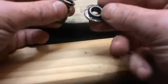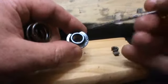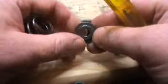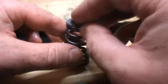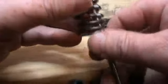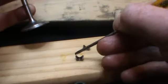The top hat — there's two ways it'll go, and only one is right. If you look at the diameter there, the inside diameter as opposed to that one, that one is smaller. The smaller goes down — if that's the top of your spring, smaller end goes down. The reason for that is when you put the collets — these are the collets — you'll notice that these are tapered, and the taper goes down, like so.